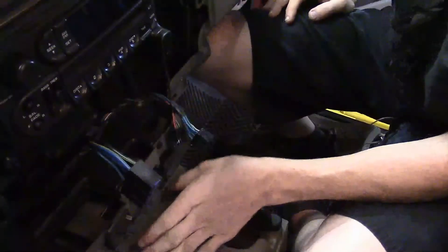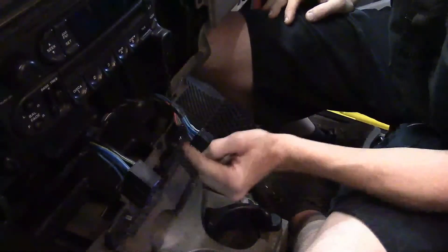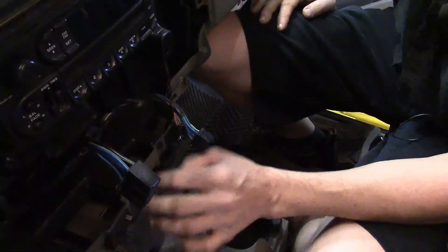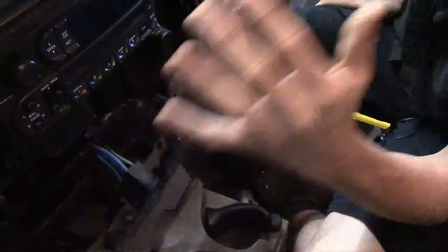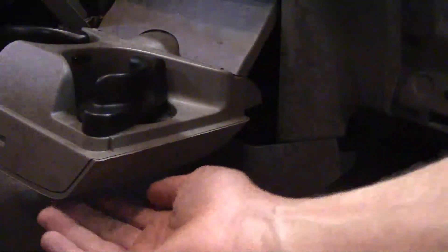Now on the top edge you can see the cup holder still in view, there are some screws around the top we're going to be working on, and the trim bezel down below. Once we get that off we're basically down to that shell — again the piece that runs from the driver's side steering column all the way over to the passenger side door. I fold the cup holder assembly up to get this plastic panel off — it just snaps in two places, grab a corner, pull loose, work your way around. Up under there are two screws related to the cup holder, plus two screws on the top.